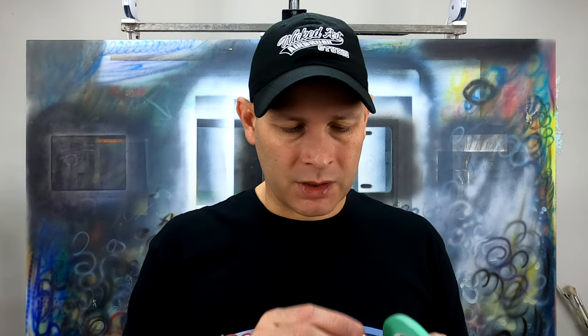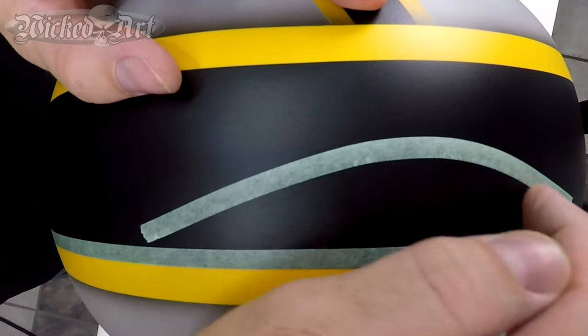That's pretty much it. I just wanted to share this because it's a product I had never tried before. This is super thin tape — it doesn't build a heavy paint edge, which makes it a lot easier to bury your edges underneath your clear coat. It's a fantastic product and I wished I'd have tried this years ago. A lot of you guys may already know about this because it's been around for a long time, but I highly recommend the 3M Precision crepe tape.